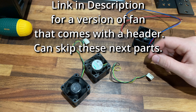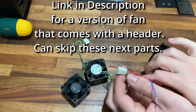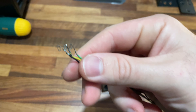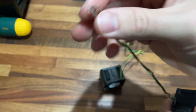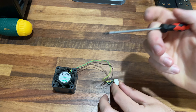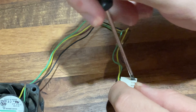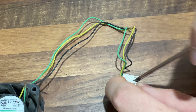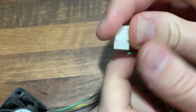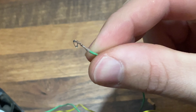The part I was most concerned about was reusing these white fan connectors. The way I'm getting these off — there are little slots here, and on the inside you have these little connector hooks. You want to compress that angle and then pull it through. I'm doing it with a small flat head screwdriver, putting it into the slot, starting with the corner, pushing down that raised part, and then pushing it. I'm rolling the screwdriver and they're coming right out. We can reuse our fan connector, but we do need to go get these little crimp pieces.